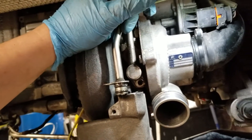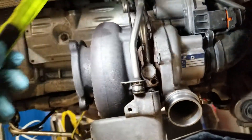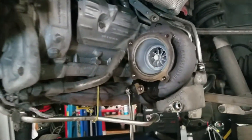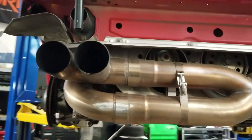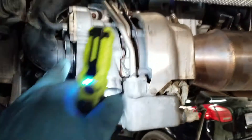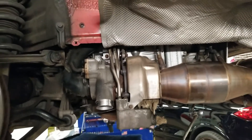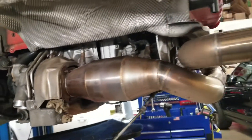We do have access to 49mm with a different style compressor wheel — it's actually 1.5mm less in one dimension. Everybody wants to go with the 65mm exducer, but the 68mm I don't recommend on this car. From our experience, a couple customers wanted the 68s and we did what they asked, but they're known for a lot more lag. If you're used to the stock VTG setup you'll be pretty disappointed. Also, the factory housings won't flow properly past right under 65mm, so it's pointless to go to 68 — it just causes problems and extra lag.